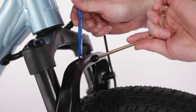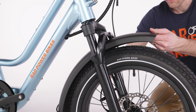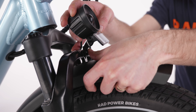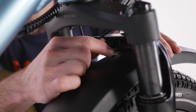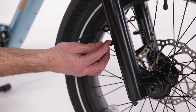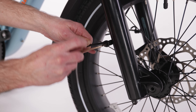Locate the headlight and front fender for installation. Use a 10mm wrench and a 5mm Allen wrench to remove the headlight mounting hardware from the fork bridge. Pass the fender from the back of the wheel forward under the fork bridge and position the mounting bracket in front of the mounting point on the fork. Pass the bolt and flat washer through the headlight mounting bracket, fender bracket, and mounting point on the fork bridge. Pass a flat washer and lock nut over the other end of the bolt and secure by hand. Use the Allen wrench and a 10mm wrench to tighten the bolt until secure. Unthread by hand or use a 4mm Allen wrench to remove the mounting hardware from the L-bracket mounting point on the fork arm. Place the fender arm eyelet over the L-bracket and thread in the bolt by hand. Secure the mounting bolt with the Allen wrench.